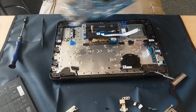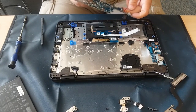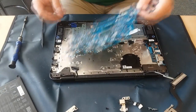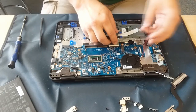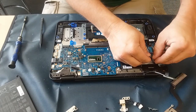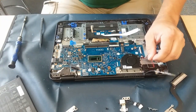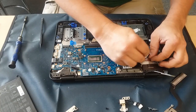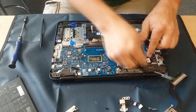I'm going to go ahead and get the new one. As you can see, the battery has come with it. Sometimes there's some tape that goes over some of those little connectors where the flat cables are, so go ahead and make sure you remove all of that — it's usually just basic yellow cellophane tape. Then just start reversing everything that I just did. This one has a brand new battery; they now attach the little wires on so you can plug them in and out, instead of the snap-down thing that desktops still pretty much do.